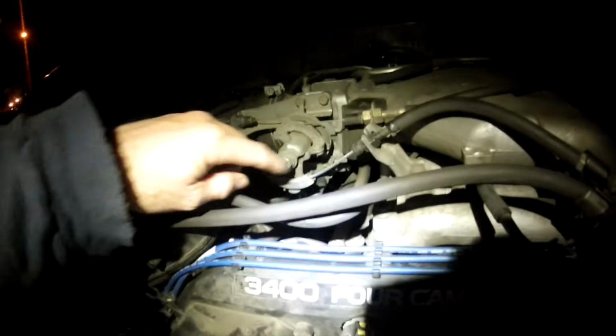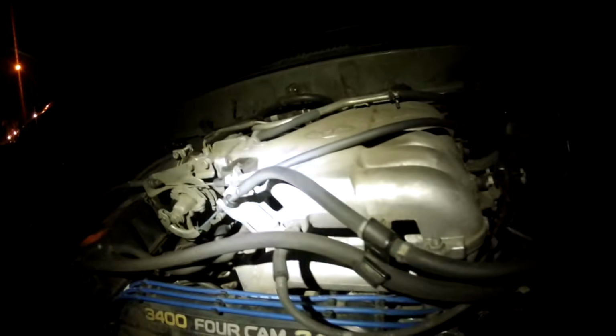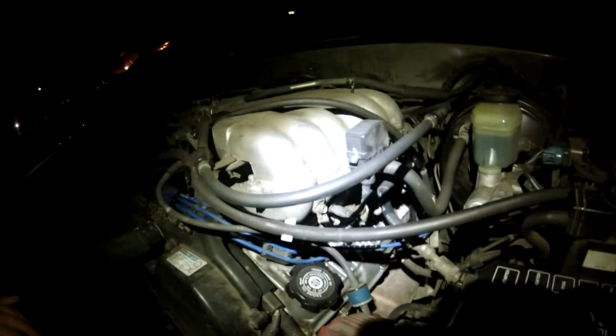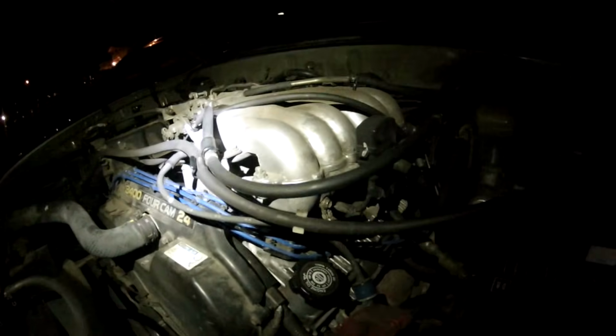And then also underneath this throttle body, I'm kind of pointing with my finger down here, there's different hose connections than underneath the throttle body of the 2002. So when I did the valve cover gaskets on this engine, what I did is I disconnected all the hoses first. I took the bolts loose and I tilted the plenum up like this to where I can get at those lower hoses much easier. So if you're working on an engine with this orientation, I suggest you do it that way to get to the lower hoses. Other than that, those are the main differences. All the other connections, the diagnostic, the fuel connection down there that attaches to the lower plenum, it's all very similar to the other engines, but there is some mild differences with the cables on the top.